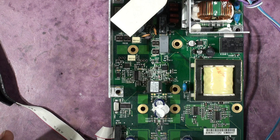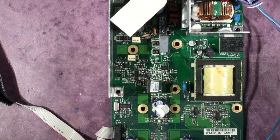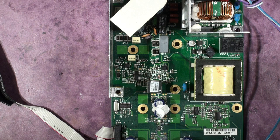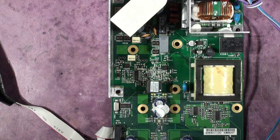If you know what the voltage issues are — it's dangerous. There's 300-odd volts on here on UK or European mains. Unless you're sure you know what you're doing, don't operate it with the covers off. And don't take it apart immediately after it's been switched on, because these things hold charge and can give you a nasty belt.